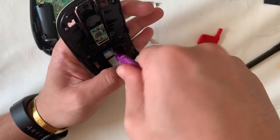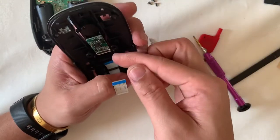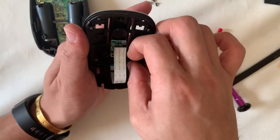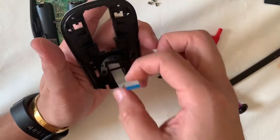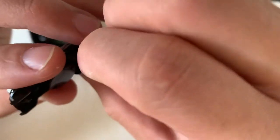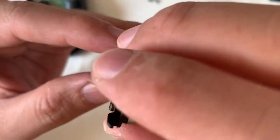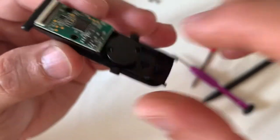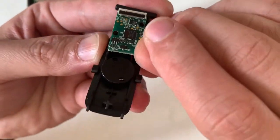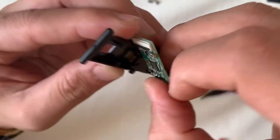The center click scroll portion is secured with two screws on a sister PCB board, and the pivot of the whole assembly is secured by three screws. I attempt to dismantle it further, but the gray portion appears to be glued shut — I don't wish to go further and end up with a non-working mouse. The leads and two wires for power are connected here.